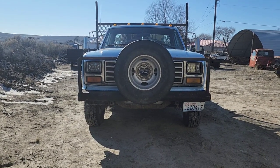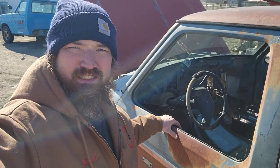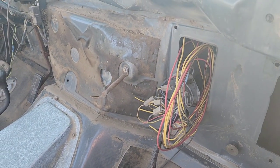Got that all buttoned up — the green wire on the headlight went to the green wire in the truck, the red wire from the headlight went to the brown wire in the truck. Those new headlights sure look good! If I taught you a little something about installing aftermarket LED headlights in your truck, or maybe you didn't know the color codes for the wiring, hit that thumbs up — it really helps out this small YouTuber trying to beat those evil algorithms. If you're into these old Ford trucks, the IDI diesels, 6.9s and 7.3s, hit that subscribe button. This here is a 7.3 IDI diesel race truck build — we're gonna have quite a few videos about it. We've basically ripped out all the wiring.